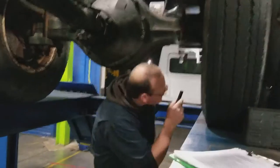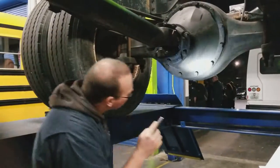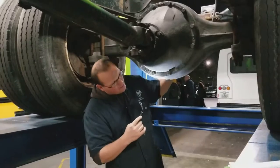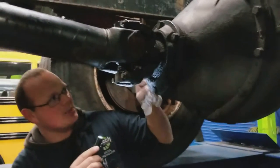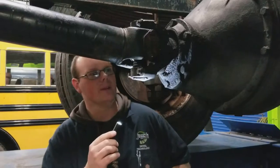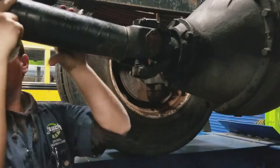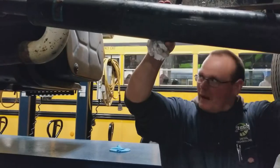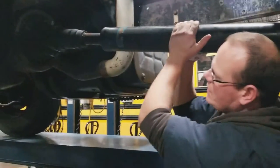The pads look new but they're very rusted. We've got a rear differential here — we can check our fluid levels once I find the plug. There's a plug right here in the middle of the pumpkin. Take the plug out and we can check our levels. I see a lot of grease on the outside of this pumpkin, which tells me the seal is probably bad on this input for the differential. Also, we're going to check movement back and forth — the driveline doesn't spin, and it's in neutral so it should. There's binding somewhere. It doesn't move up and down, which is kind of good — it should move a little but it doesn't, so there's binding.